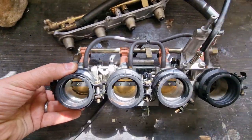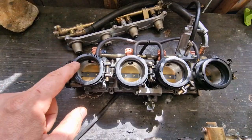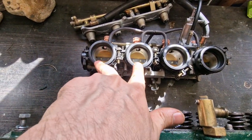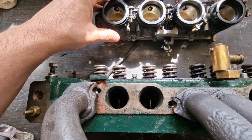Hello and welcome back, my name's Jim and in this episode we're going to make a start on an inlet manifold for the injection project. These are the throttle bodies in question - they're off the CBR600, with a 38mm bore, which is the same as what you'd want from a DCOE40 once you put the choke plate and everything in. The centers between these are 74.5mm and I believe just under 48mm.